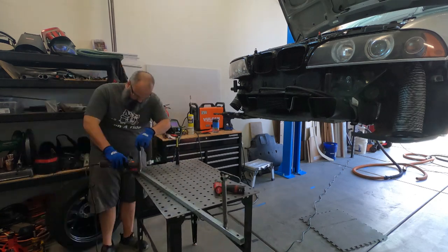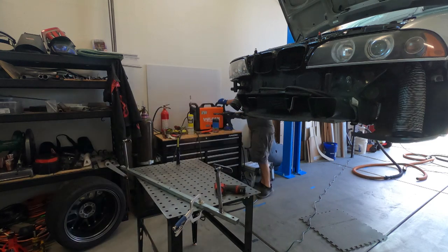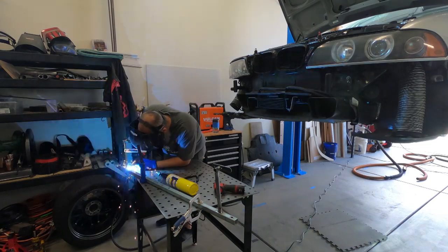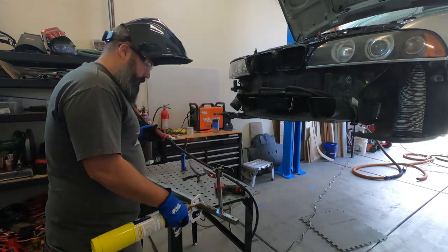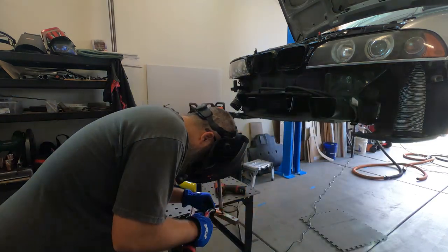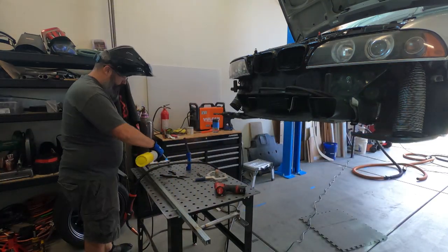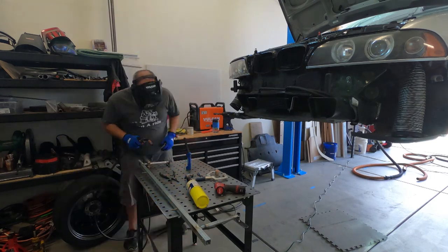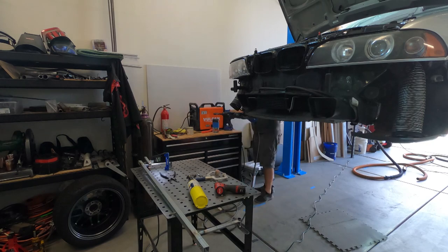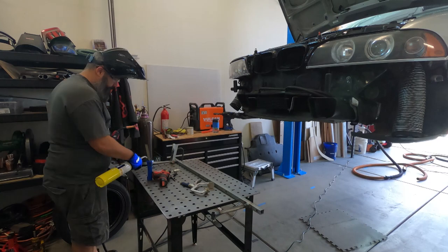While it was drying, I was off to finishing the welding process on my support tube. Again, just like before, I preheat when I have thick metal up against thin metal to try to get better penetration on the thicker side. And I just ran beads around everything here using a Harbor Freight Vulcan machine — nothing special, MIG with 75/25 gas. I am adjusting the settings on the welder as I'm welding different thicknesses.